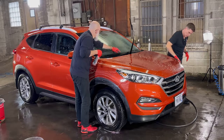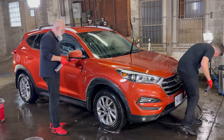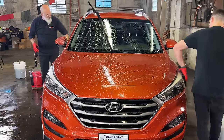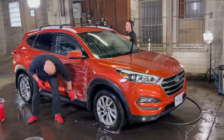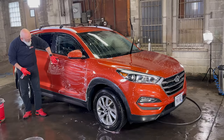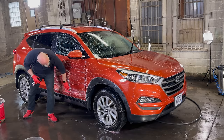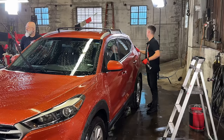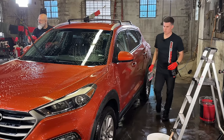Don't forget to decontaminate your windshield — and all windows — it makes them much easier to clean. Some people spray the entire vehicle with iron remover first, but that's an inefficient use of a product that's quite expensive and quite fragrant. If there's a scratchy sound going over the bottom of a door, let the iron remover dwell while doing the upper sections — it'll have time to work on those rust stains and iron balls to make them easier to dislodge.